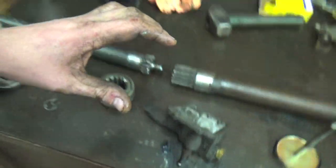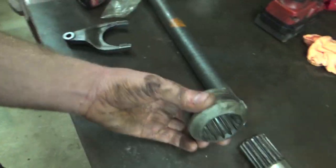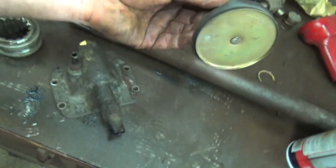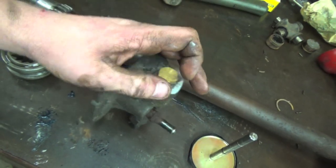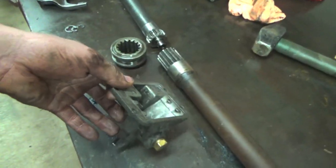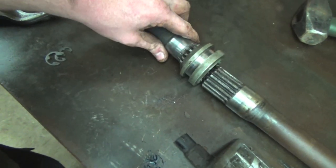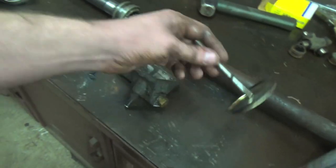When you put it in four-wheel drive, there's actually a vacuum hub on top of the transfer case that pushes a little diaphragm over, pushing this dog clutch over and engaging the axle shafts together. We deleted all our vacuum systems on this truck so we're going to permanently lock this. We've already started by cutting off the vacuum hub itself, threading and tapping an NPT fitting right there. You can buy one big axle shaft but it's expensive — this is pretty much free to do, you just need some taps and a pipe fitting. This dog clutch rides between the two pieces and is what connects them, so we're going to permanently mesh these two together by permanently holding this in one spot.